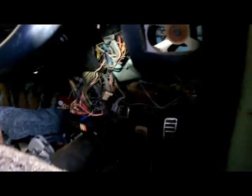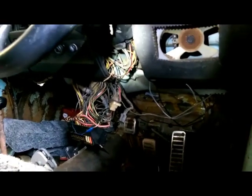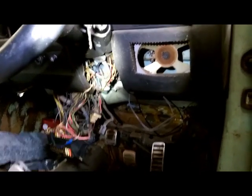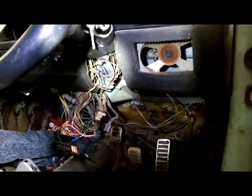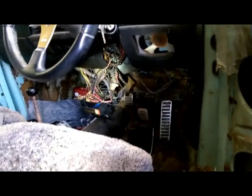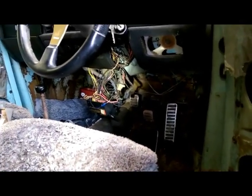Same rust spot on the driver's side but not quite as bad. Also, the fun part of these curved windshield super beetles is the wiring loom is wedged between the dashboard and the firewall, so there's pretty much no access to work on it with the dashboard in. And what 40-something-year-old VW is complete without wiring issues? This beetle has had a wiring short which has melted all the insulation off a wire and melted it into all the others up there. It's obviously been replaced and everything actually works, but I want to get that loom all tidied up and replace any damaged wires.